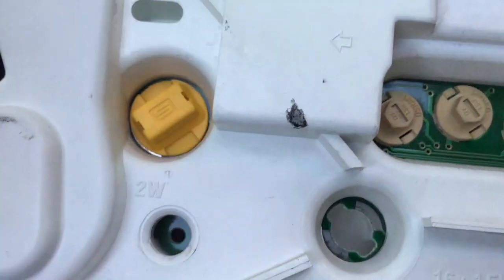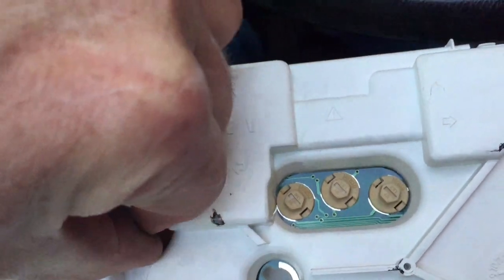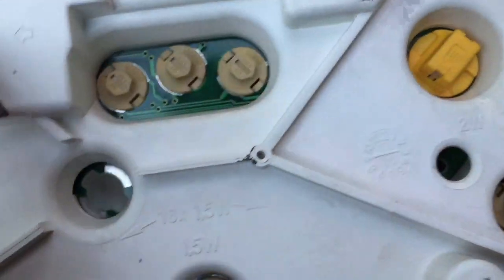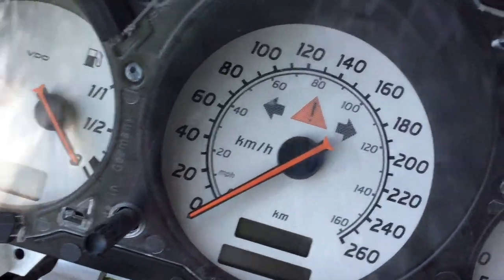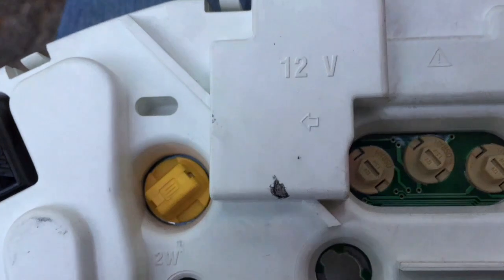On the back of the cluster — we're reversed now — this is the bulb that's out right here. I'm just swapping the bulb; it's a T10, also known as a 194. There are basically three or two big panel lights and two or four small ones on the sides. The two main ones in the center and the two on the sides — if one of the main ones is gone, half your gauge will be dark. For me it's going to be this one.